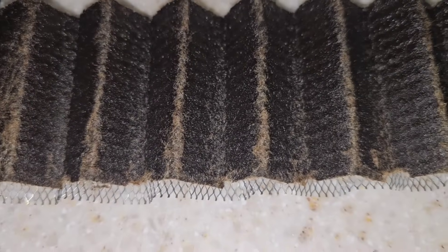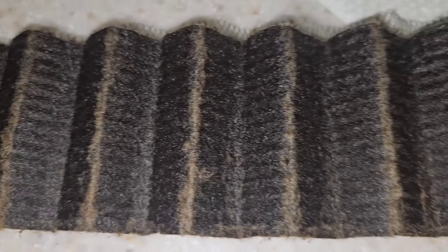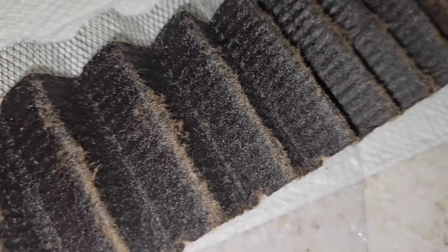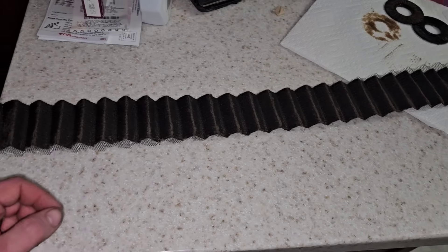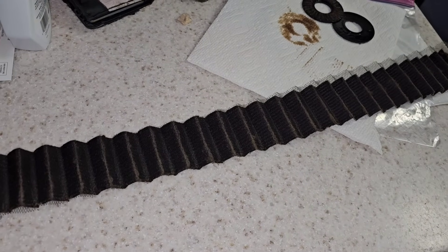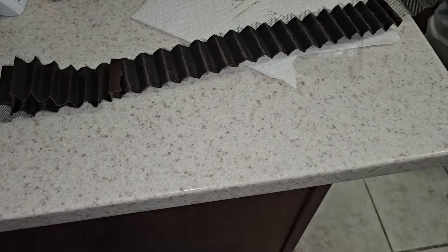No cuts, no edits, just raw. It's very clean. I don't see any chunks of anything in the middle. The oil he's running is Schaefer Supreme 9000, which is a PAO-based formula — it's very clean. You can definitely tell at 15,000 miles it has compromised the integrity of this filter, because that tore apart way too easy. It shouldn't have been that easy to tear apart, but as they age and get heat soaked over and over again, this is what happens. Here's the back side of the filter — clean, very clean, doesn't smell like fuel or anything at all.